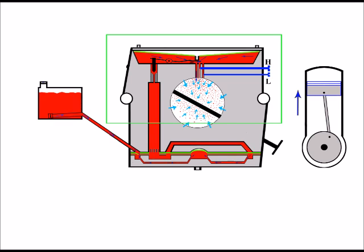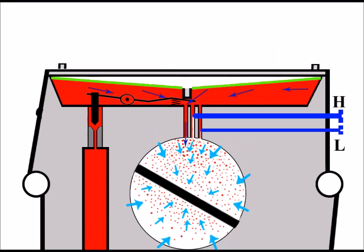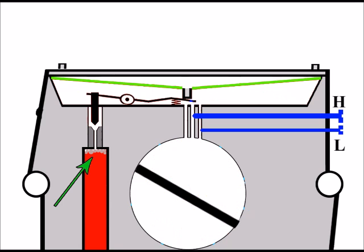I want to focus in on this area here. This is the metering area of the carb. Now if we quickly jump back to small amounts of debris and blockages, we can see that small orifice there underneath the needle valve and its seat that wouldn't be too difficult to block. And it's vital that the fuel passes through there in order to get above to the metering area. But if we do get a blockage there, then obviously we know we're not going to get any fuel up to the top of the metering area.